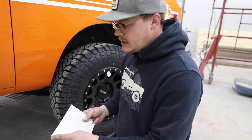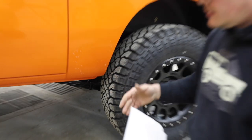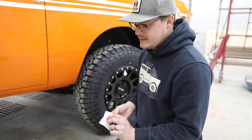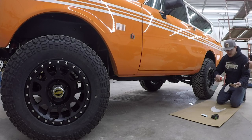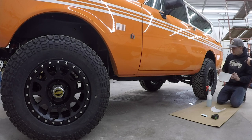I have my panel here. First I'm going to take my soapy water solution and spray down the truck panel around where this panel is going to sit. You want just kind of a light covering on the panel itself. If you live in a dry environment — it's winter here in Iowa and we have a lot of static currently — it's really important that the backing paper has lubrication on it when you start separating it, otherwise it'll want to curl and do some weird stuff. Spraying a couple areas as you start peeling the film off with the soapy water will keep that from happening, and it also adds another level of lubrication on the panel before it goes on the truck.